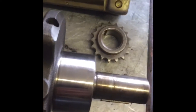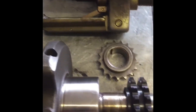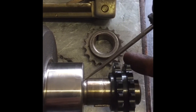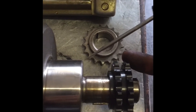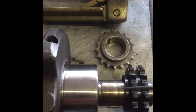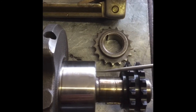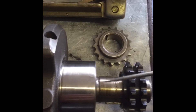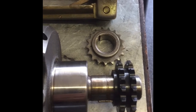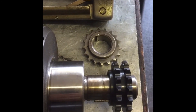You can just put the double-row straight on the crank and press it into place, but if you do that the bulky rivets from the end of the chain chew into the edge of the number one main bearing journal. It's not major, but it's better if we don't have the chain chewing lumps out of the end of the crank. So the next step is to put the crankshaft in a lathe and machine a small amount off the end of the main journal, just to allow clearance for the rivets. It has no effect on the strength of the crankshaft or the bearing surface whatsoever — it's purely an improvement in reducing metal shavings in the oil and potentially helping the life of the chain itself.